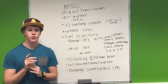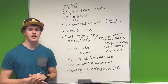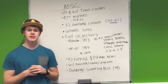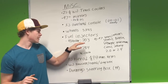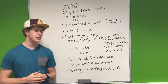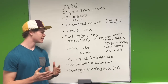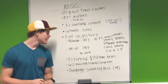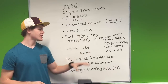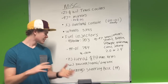Next one is fuel injectors. Stock Cherokee fuel injectors have one hole; these ones have four. They don't flow more — they're not higher-pound injectors — but the four holes are said to atomize the fuel better and give you better fuel economy. If you have a 98 or older Cherokee, you want the injector ending in part number 703. These can be found in 1995 to 1997 Neons, Caravans, Grand Caravans, Stratus, Breeze, Voyager, Grand Voyager, Cirrus, and Sebrings — all Dodge/Chrysler vehicles with a 2.0 or 2.4 liter. For a 99 to 2001 Cherokee, look for the part number ending in 784. I'll put the exact part numbers in the description. They're found on the same vehicles from 98 to around 2000 — just double-check the part number on 2000 models since they started phasing those out.